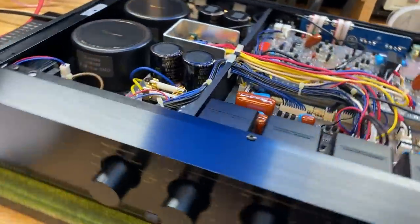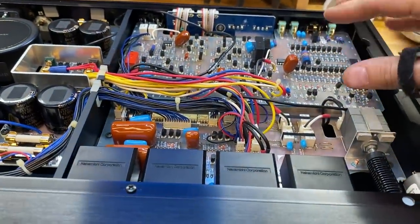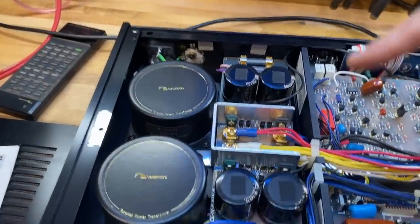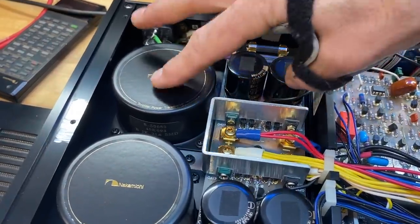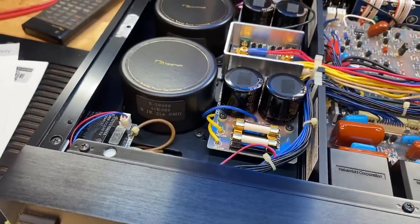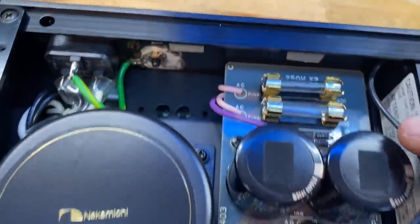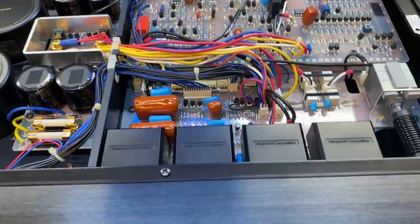I'm going to unplug it so I can show you the layout. Even though the circuitry is divided into left and right channels, it does share a common power supply, so it's not a true dual mono design, but it's pretty close. You can see the two large power supply sections here on the left. According to my colleague Ben, one powers the entire phono stage — the moving coil section. It's a fully regulated power supply. The front power supply powers the rest of the preamp controls and signal path. They use gold-plated terminals throughout — even the fuse buses are gold-plated. You can just tell the attention to detail and quality.